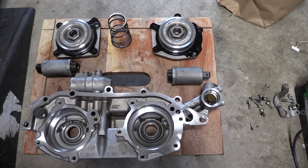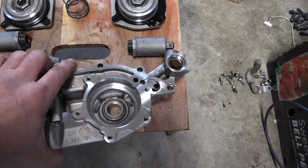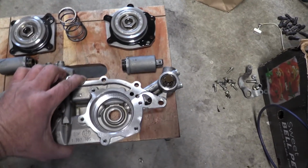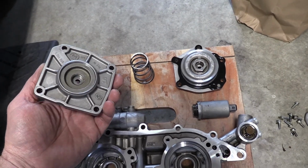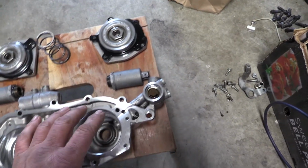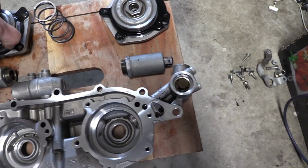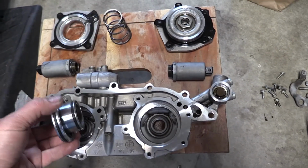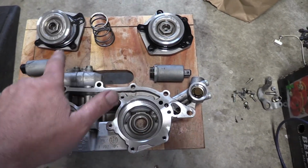Alright, continuing on. It's a pretty rainy day here today, but we've got the Vanos body here cleaned up. It's super clean as I can get it, and cleaned out the solenoids, got the pistons resealed, and these are super clean as well. They move real well. They were really loose fitting before, but they fit tightly into this part as well. It's a two-stage, two sets of seals here, the inner and the outer. They fit a nice tight fit in this one as well as this one, and we're going to put them back together. New gaskets came with the kit.